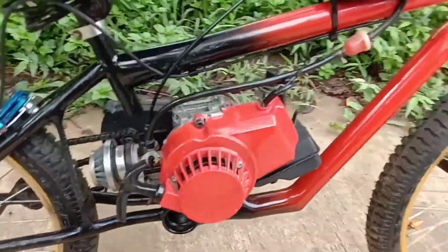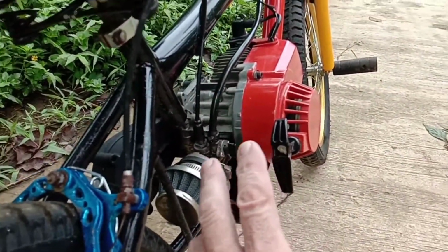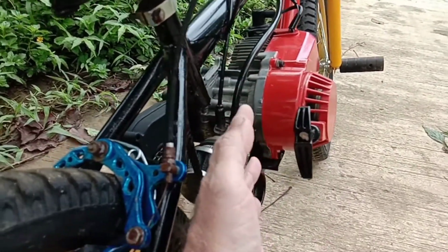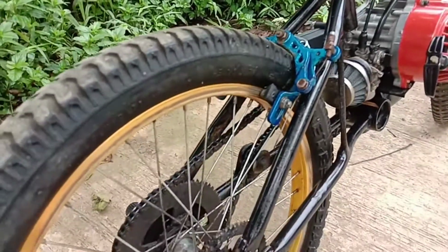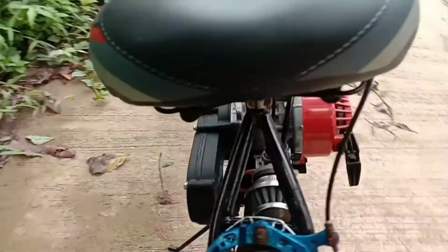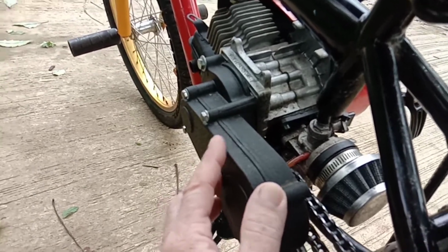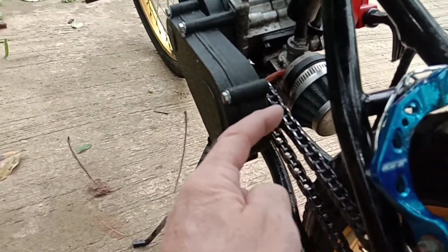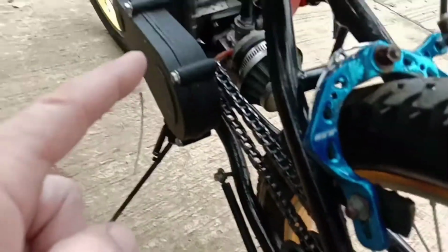And then at first I had bought the motor with the little clutch on it for a pocket bike, but to line the little gear up with the back one, the motor was sticking way out. I'm like, nah, I don't want to do that. So then I ordered the ATV gearbox, or the little dirt bike gearbox, and that has a sprocket real close to the carb so that my motor is a little bit more centered than it would be.